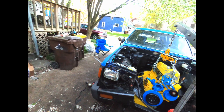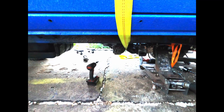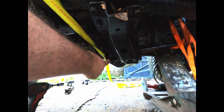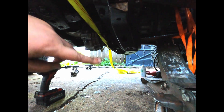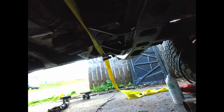When you're working alone you have to be creative. I had to extend the crossmember back with a Doomsday bracket kit. I wanted that to set the fore-and-aft location, so I took a ratchet strap off a little furniture-moving dolly, wrapped it around the 4Runner, ratcheted the rear up, jacked the front up, and then lifted the transmission, transfer case, and crossmember into position. There's a little nub it locates on — it's not bolted in yet, I've got to round up some bolts. I'll deal with that tomorrow; it's getting dark.